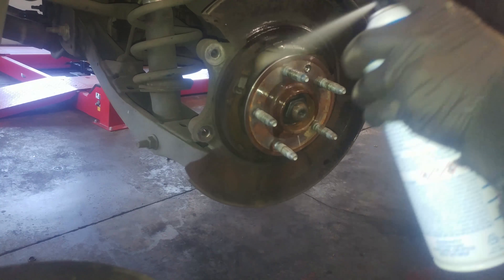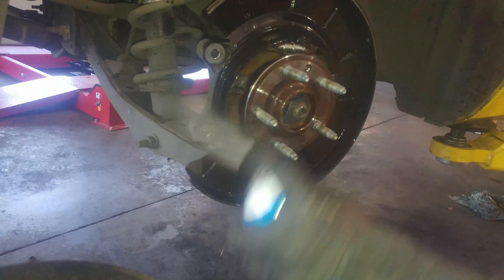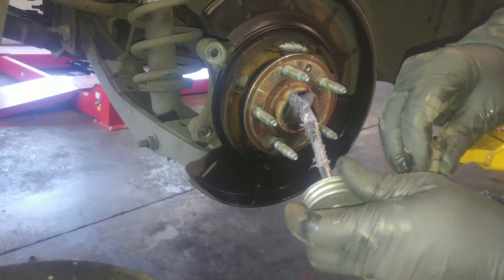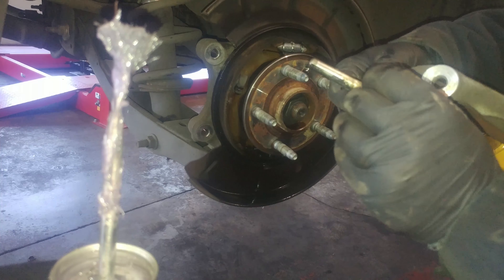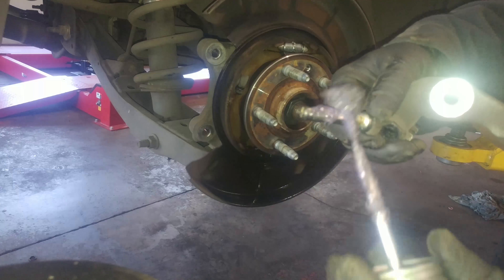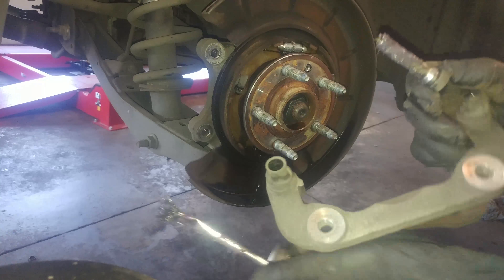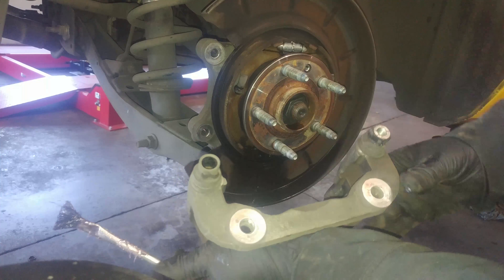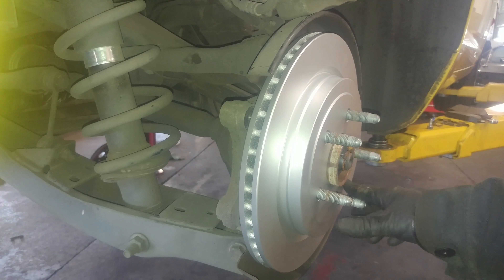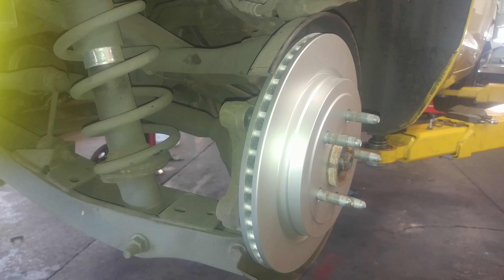Give these a little cleaning with some brake cleaner. Put the lubricant on there and back in the hole. Alright — got the rotor on, got the torx bit back in, probably around 89 to 100 inch-pounds, something like that. Just make it tight. If you lost it, it wouldn't be a big deal — many rotors don't have anything holding them on.